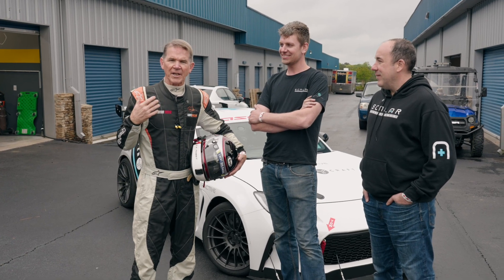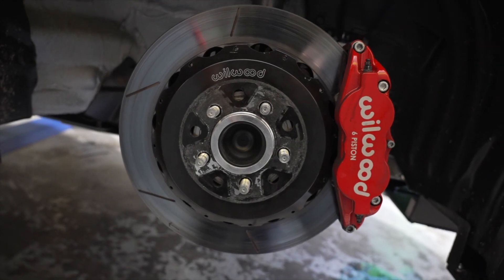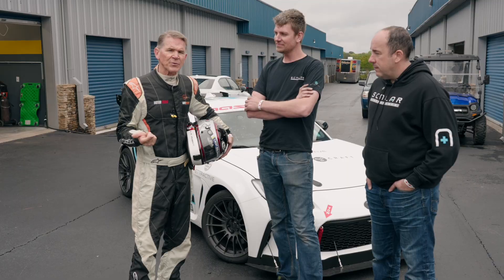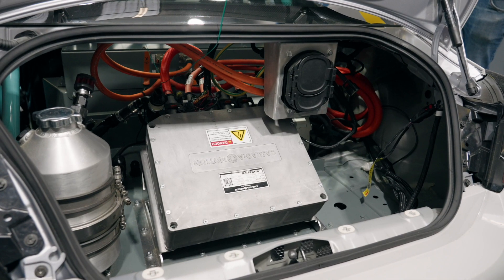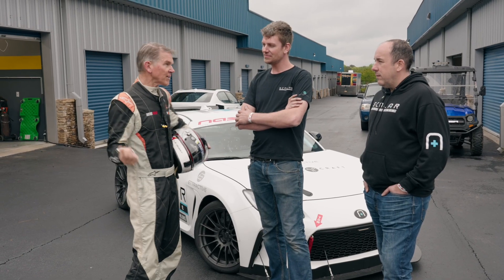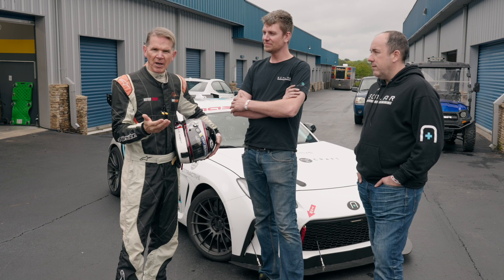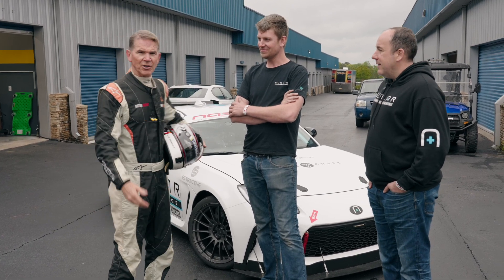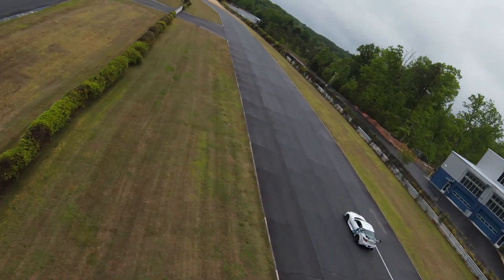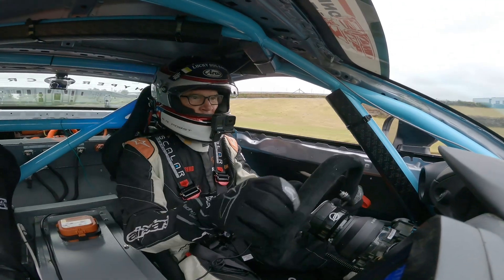We got my first test day in the Scalar SCR1. Dealing with a lot of weather — it was wet, slowly dried out. Working on things like adjusting the brake regen, which is part of the brake bias in the brake system of this car. I did some suspension adjustments and we found some snap oversteer from that brake adjustment. It was interesting trying to figure out what was chassis and what was drivetrain affecting the handling. I asked Joel to crank up the front bar a little bit and we went back out, but the track was dry. The car handled so much better, but there was so much more grip. We need more testing to figure that out, but the drivetrain performed beautifully and the car is super nice to drive. It's certainly a very educational day for us too — Randy's ability to jump in the car and feel things out is amazing, so thank you so much for working on the suspension and the regen maps.